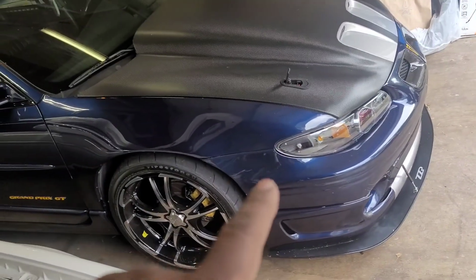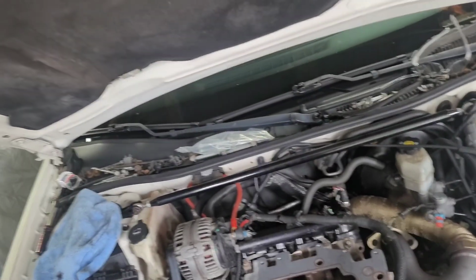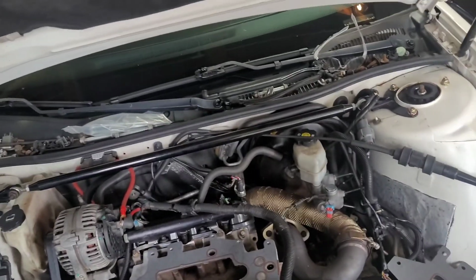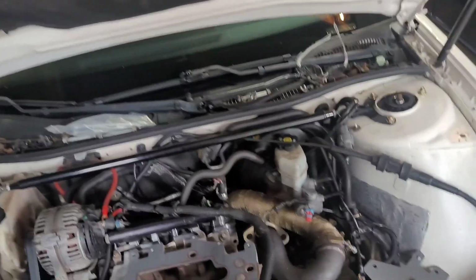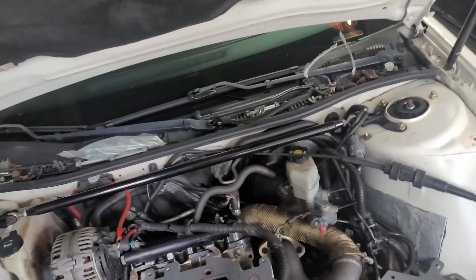I even tried to blow air through and there's nothing going through. So that's how I confirmed that I don't have PCV, which is okay. So we just have to run a breather, which is the same ordeal I had to do on my brother's car, because he has the same heat exchangers or intercooler core as I do. So, okay, we're all caught up now. I'm sorry if I've been babbling too fast, but I had to get you caught up with what's going on.